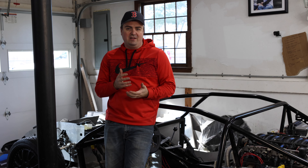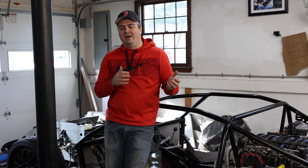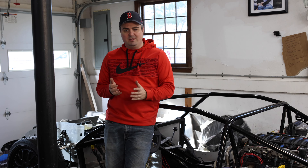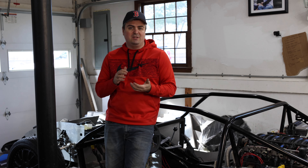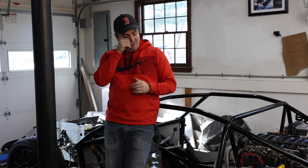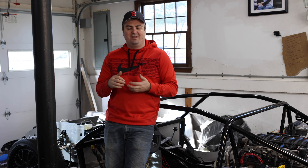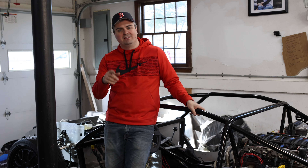So we made some pretty decent progress on the car. I wanted to get the battery and everything hooked up, but since I don't have a four gauge crimper and I don't have the right length braided ground strap to go to the chassis, I'm not going to risk it — we're going to have to try to start it next week. But what we were able to do today: we showed that by turning the key on, the ignition light comes on, and by pushing the start button, the starter light turns on. So we're one step closer. I can start looking at wrapping up some of the wires, cutting them to the right length. I have the correct hardware coming — the right terminal sizes and the right crimpers. Thanks for tuning in to Smacky's Garage, I'll see you next time.